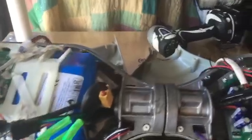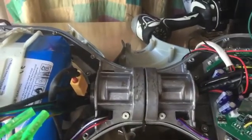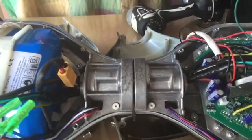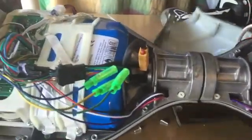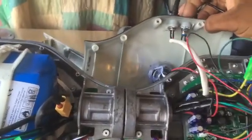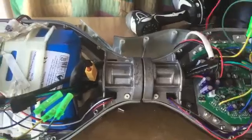After you've made sure all your wires are tightly connected and everything is in place, you want to test the new motherboard to make sure it's good. You can do this one of two ways: you can use this pin socket here, short it out, and it comes on — so we know this motherboard is good. Short it out again and that turns it off. Or you can temporarily hook up your power button to the two-pin harness and press it to make sure it turns on. We're good to go — this motherboard is good. Disconnect your power button because you need it out of the way.